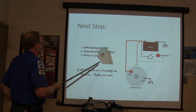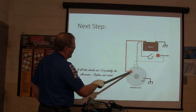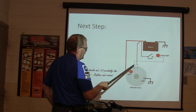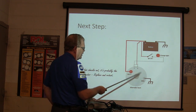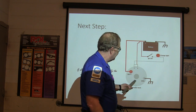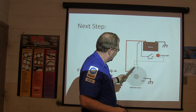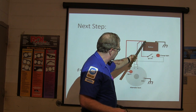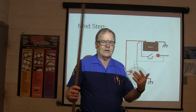Next step: battery charge light on, wires connected to the alternator, strong 12-volt power at the big alternator terminal. You've got to have 12 volts there. If that wire is broken, it's not going to charge. Make sure your charge light's working — your ignition is what sends 12 volts through there to turn on the regulator. There's also a sense wire that tells the internal voltage regulator how much voltage is in the battery so it knows what to do. I actually fell into a trap one time — I put an alternator on without checking this stuff, and there was something wrong with the wiring, so it still didn't charge.